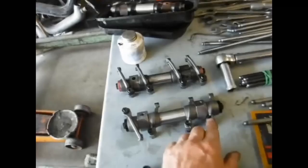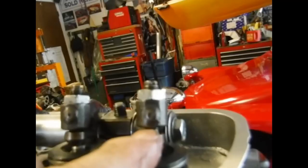You'll notice this one just has a cup on the end. On the setup I'm using - I don't know if you call these elephant feet or swivel feet - there's a ball in the end with a little flat spot on it and it takes up space. If you're adding these to a stock engine you're going to have to raise your rocker arm assembly up. They have shims underneath here - you can see them - they come in different thicknesses.